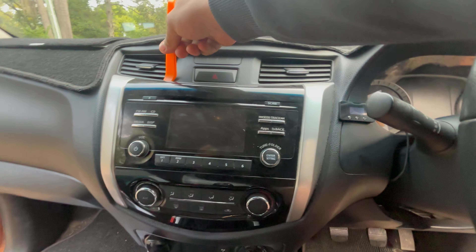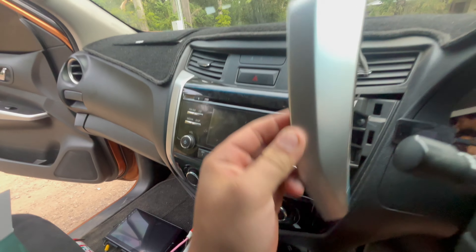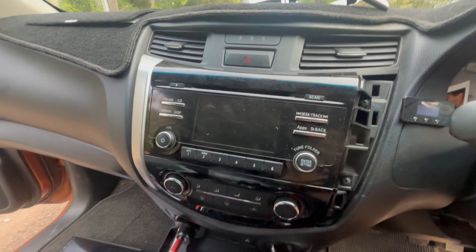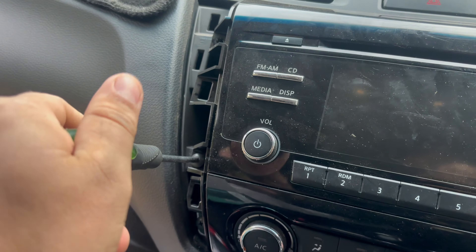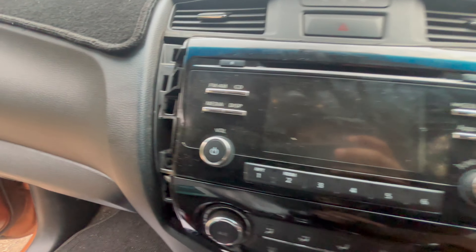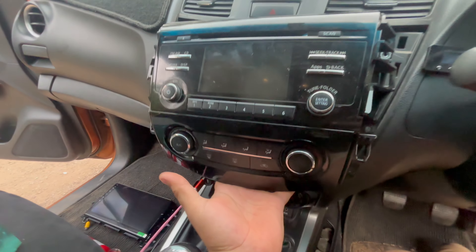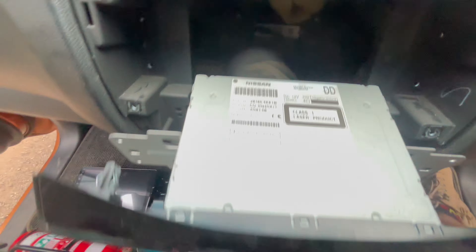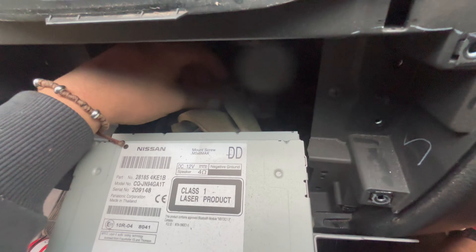There we go — got one. It's just me flexing my dash. I started by popping this one off, and I'm going to pop that one off — it looks like it's going to give you access to a screw there and there, so it should be pretty easy. I've gotten the four screws out and tried giving it a pull but it won't come out, so I think I've got to undo those ones in there too. I've got the whole thing out now — I had to undo the aircon control ones too. On the back here it looks like they just clip in, so I'm going to have to unplug that because the aircon stays and that screen goes in. I'm going to unplug everything on the back here so I can get it all free and start working.